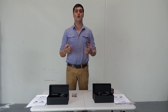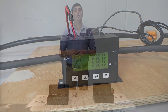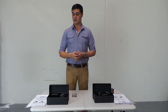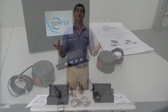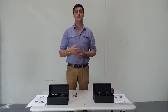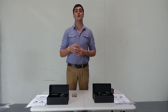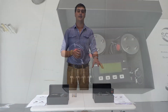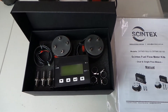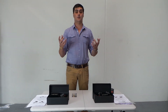There are four variations on the kit overall. You have a digital gauge option or a Bluetooth option, and you have a single flow meter or dual flow meter — they all serve different purposes. The single flow meter is generally used when you're running a smaller petrol engine or on an engine that only has a supply line. The dual flow meter kit, on the other hand, is used in engines that have a supply and return line — this is often on larger diesels.